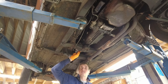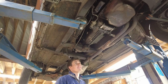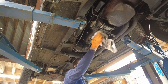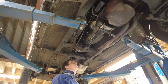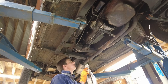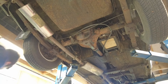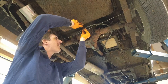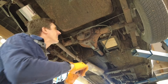I had the strainer plate off before because I was trying to get the overdrive working when I bought the car — it didn't work. As a process of elimination I checked, cleaned the screen, and actually replaced the screen. You can throw a spanner on that drain plug and the overdrive unit as well. While I'm under the car, it's sensible practice to check the level in the rear axle too — and I can tell you straight away, that's full.